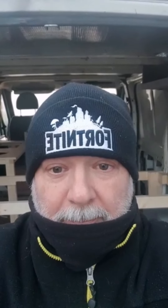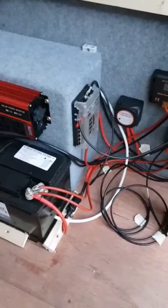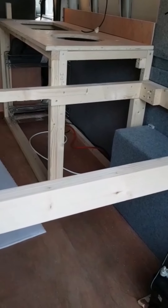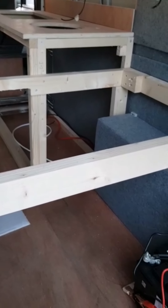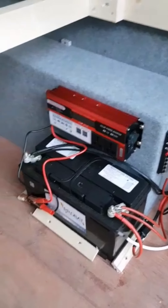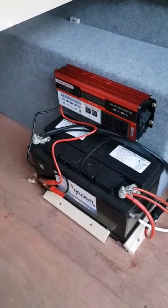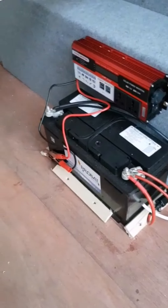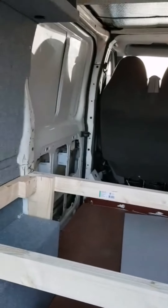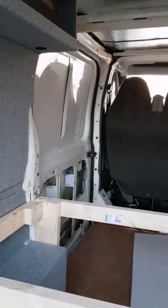With the driver's side window where the kitchen is. Hopefully I'll just have to see how it goes but I'll let you know. So for today's jobs I'm going to wire in the 240 volt plug for the fridge and then connect it to the converter. I'm also going to connect the converter permanently to the battery with some ring connectors and then I might have a look at where I'm going to put the control panel. I'm not actually sure yet.